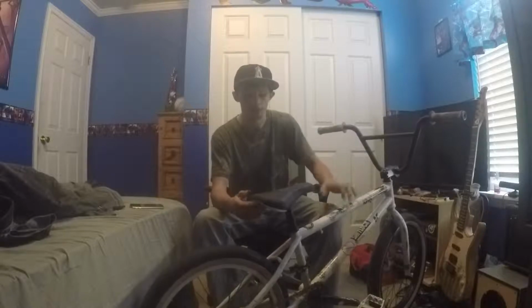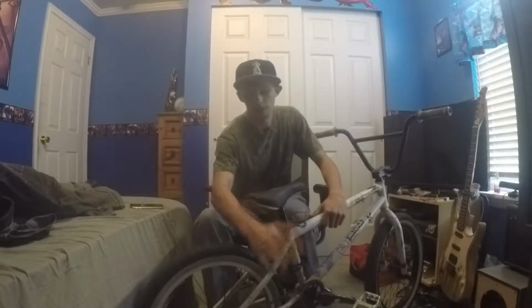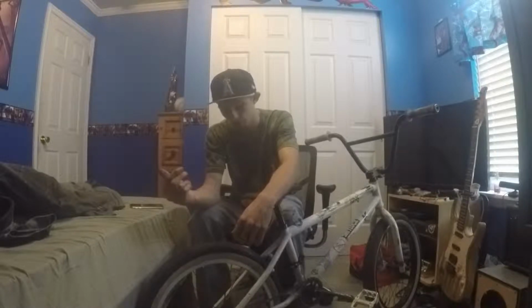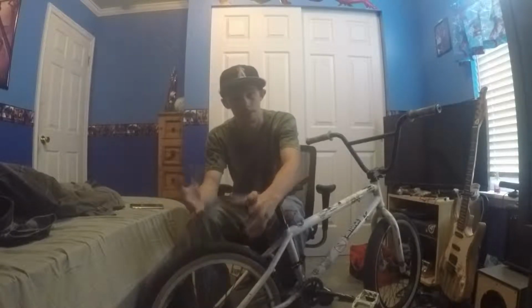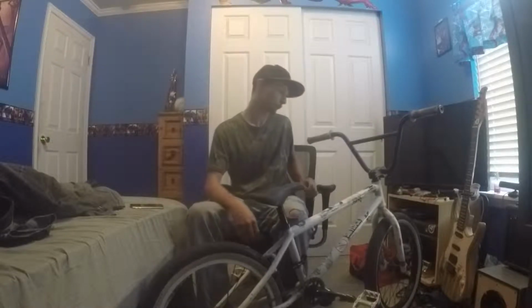Okay. So chainstay. These are the chainstays. The longer they are, the harder it is to spin, but the easier it is to go fast forward. When they are short, it gives you less area and you can spin on this back tire really easy. I can't think of a frame, but there are frames that have really small, slammed kind of ones.